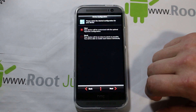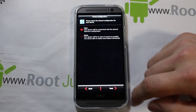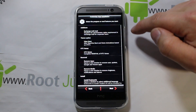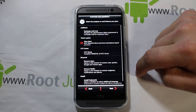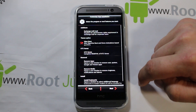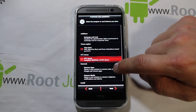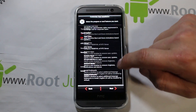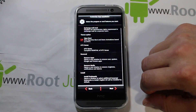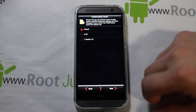It gives you 'Install without wipe' or 'Wipe data' — I already wiped data so I'm just going to go ahead and install without wiping. Then it says 'Select your desired configuration for your device.' There's Viper config — your device will be optimized for Viper One — or as close to stock as possible. We want Viper, so we'll do that. Then you can pick some extras: Viper boot animation, complete removal of HTC Sense, remove apps, remove media, install keyboard. I'm not going to completely remove that stuff right now — you can always go back and reflash to change the setup.